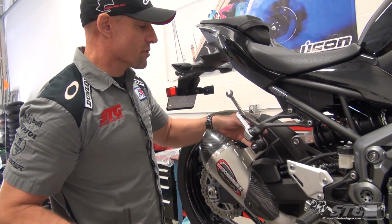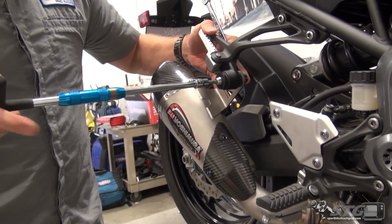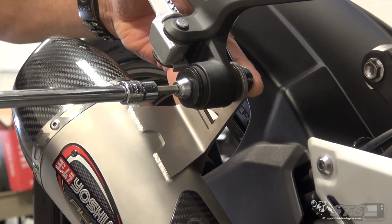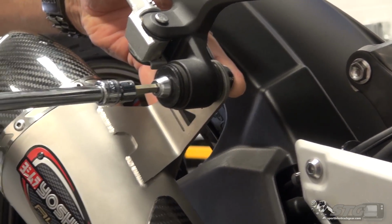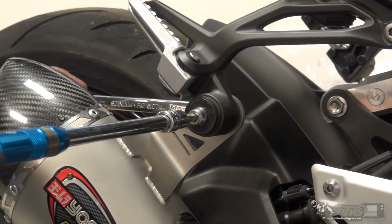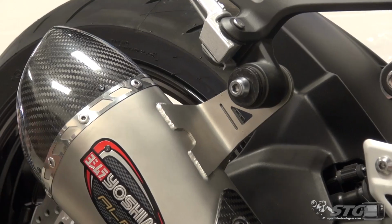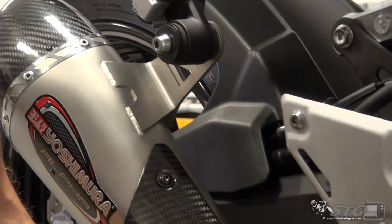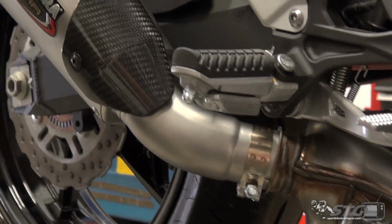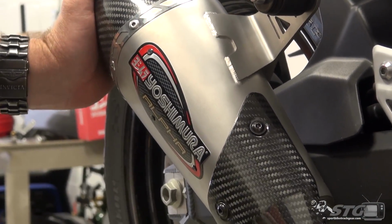All right, now I'm gonna go ahead and tighten up the mount here in the back, right? This type of system, I wanna secure it here in the rear before I tighten that barrel clamp. The nut that is used from the factory is a locking style nut, so realistically Loctite in that scenario is not really necessary. It came with a closeout panel too, and I want to get this into position and see how that's going to work with our stock setup.